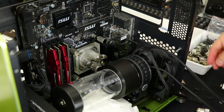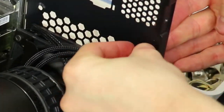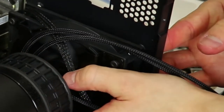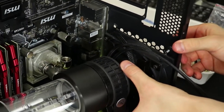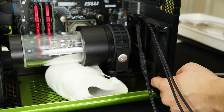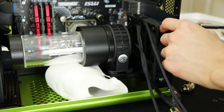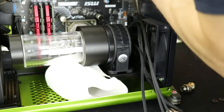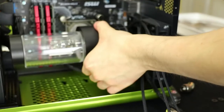In this situation, the fan needs packing out from the case to properly support the pump-to-CPU connection. There is a set with one steel washer to provide the platform for two rubber washers on a set of spare bolts. Due to accessibility, I was unable to reach the bottom corner of the fan, so this unit is being held on by three sets of nuts, washers and bolts — and the connection is solid.